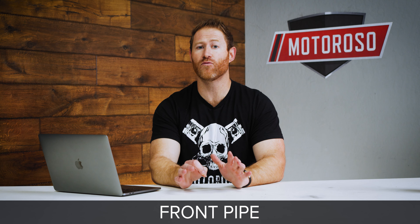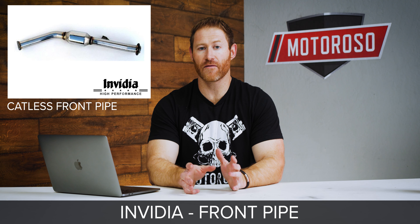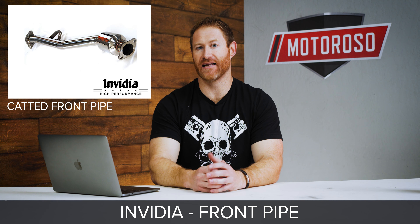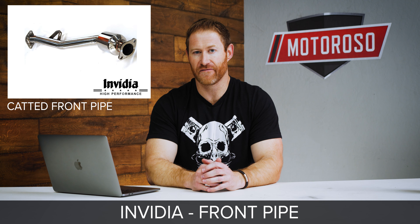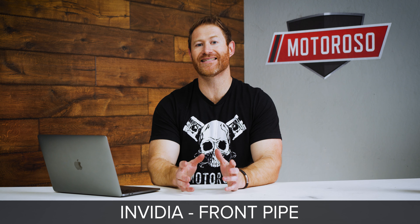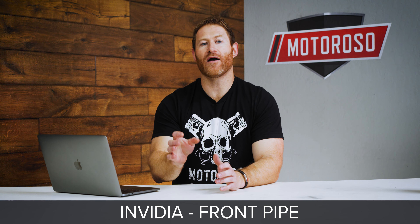Your next two options are made by Tomei, a really well-known brand in the JDM industry. They make two choices — equal length or unequal length — both set you back around $750. They're both catless and both weigh around 15 pounds, which is only a five or six pound savings from your exhaust manifold. They produce 10 to 15 horsepower without a cat-back system and up to 20 additional horsepower if you combine it with a cat-back system. They're going to give you a very loud, aggressive, racy sound that they're known for. The equal length headers are going to give you a little bit more top end torque gain and keep the sound more like a traditional four-cylinder.